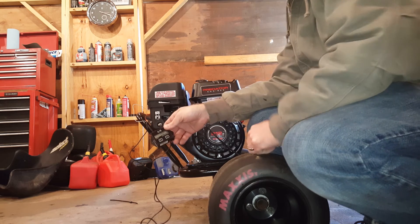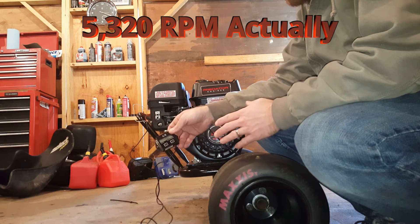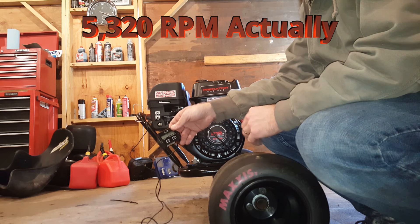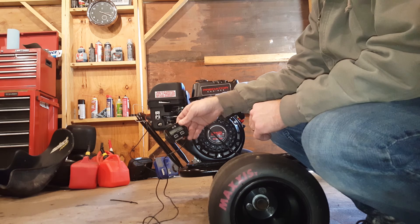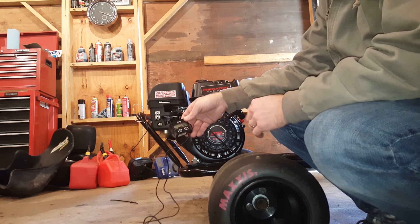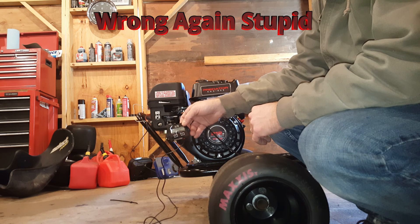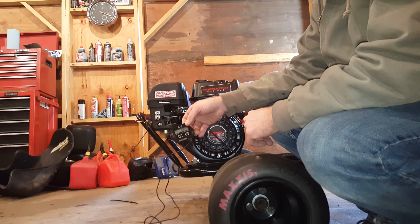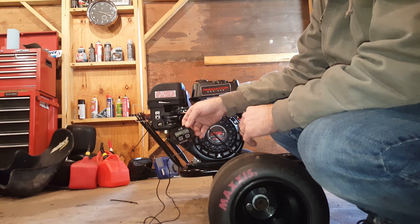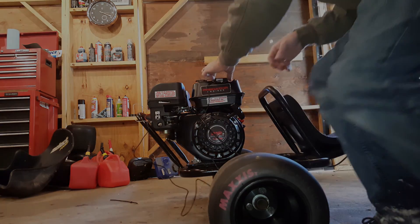All right guys, I can see we went just north of 5200 RPM, which is what I kind of thought was the stock valve spring limit as far as RPM. So if you're ever curious what RPM it'll run — 5240 I think it was — you can see it pretty clearly on the video. It takes a little while for the tach to catch up, so I left it up there for about five seconds. Thanks for watching guys.